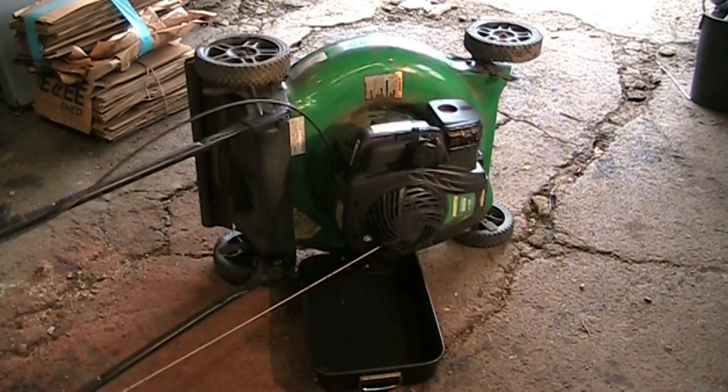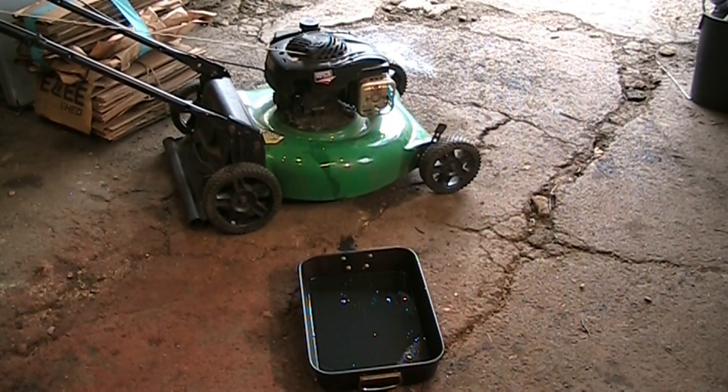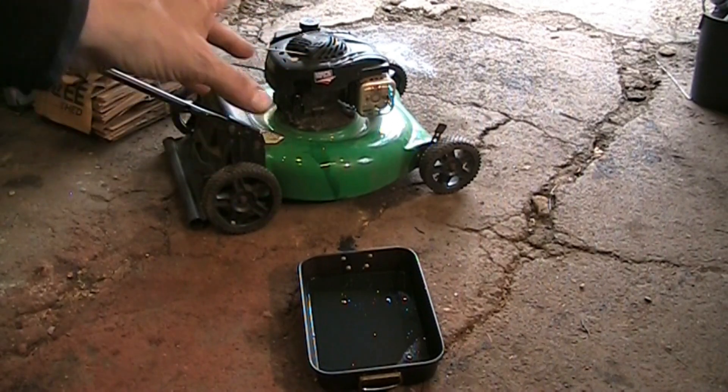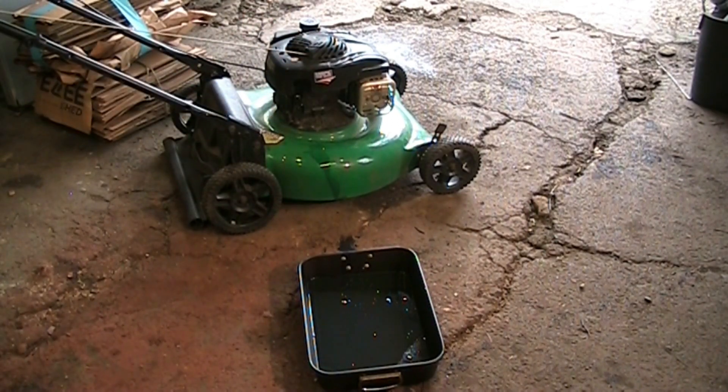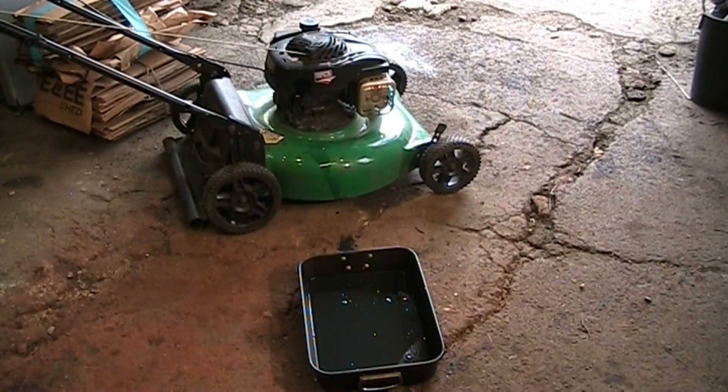She's down to drips - a little bit on the floor, a little bit on the deck, nothing too crazy. The blade is actually not even dull - it was only used for one season. It's a little rusty but still sharp. I'm going to refill it with straight 30, fire it up again to make sure the carb didn't dump a bunch of fuel in the engine from having it up on its side. Then this one's done - call the customer and tell them to come get it.